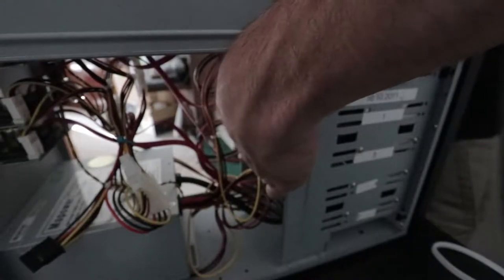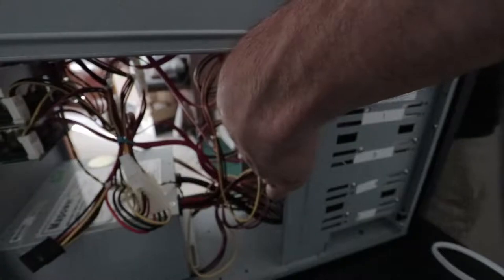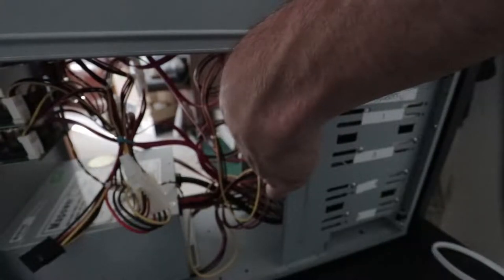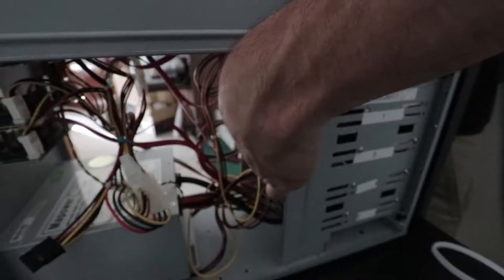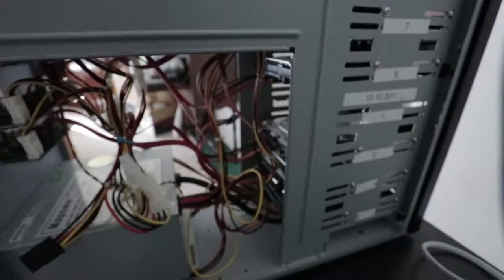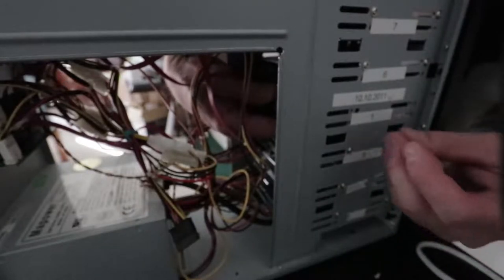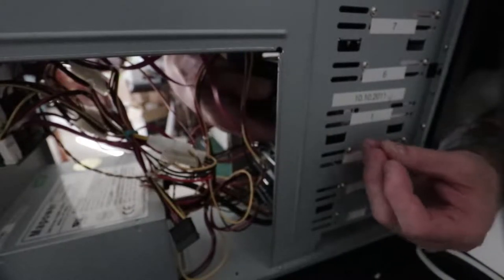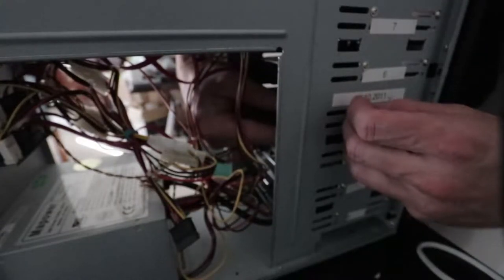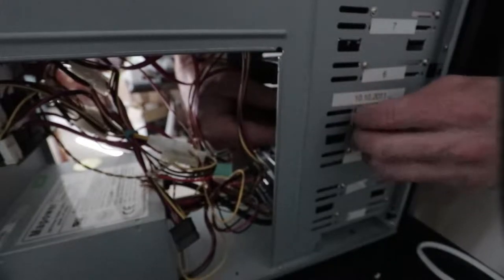These 8 2-terabyte drives are going to be in RAID 1 plus 0 with SoftRaid for Mac. It's going to give me 8 terabytes of pretty fast, accessible, and pretty redundant storage. It dates out at October 2011. It's the second bad drive in this. I don't trust these drives. That's why I'm putting this RAID 1 plus 0 on this setup.